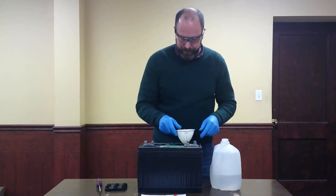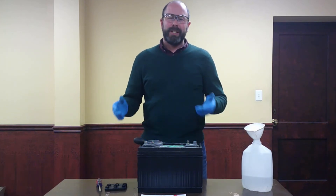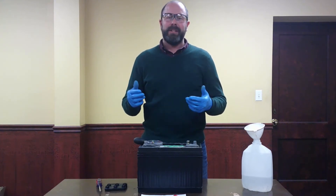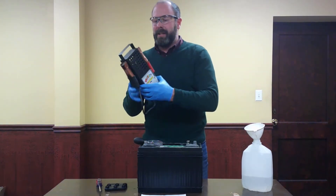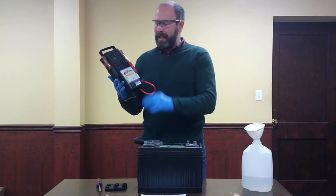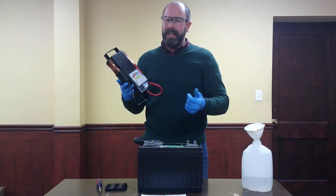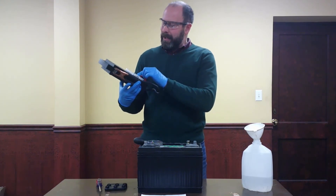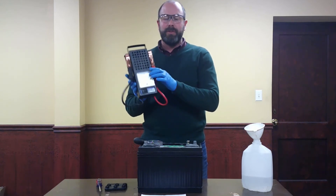We're going to do that to each of the cells. This is the bonus section of battery maintenance. I'm going to show you a couple of tools you can use to check the life expectancy and health of your battery. One tool you can use is a load tester. This is a really simple little device that you just connect to the positive and negative leads. You push a button and that applies a load — basically a little heater — and you can see if your battery is going to hold up under a load. It gives a bad, weak, or okay rating. That's something we sometimes use out in the field.